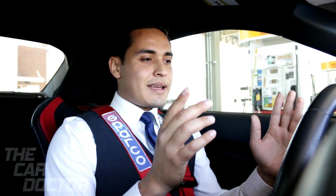Now we need to go ahead and fill it up on E85, because when we did the tune, I had about half a tank of 91 octane, and then I had to bring E85 to fill it up to see how high we can get the percentage rating. So we got it up to E60.